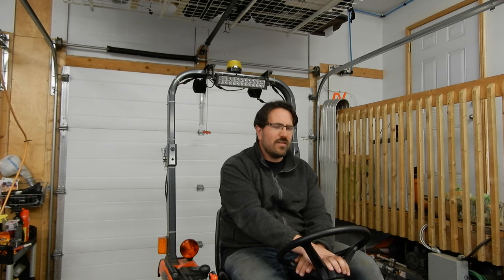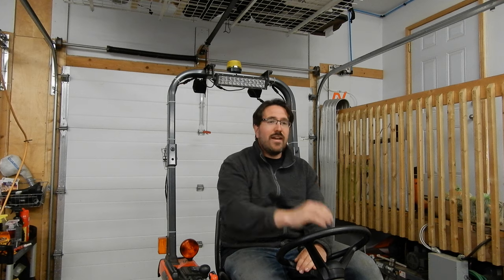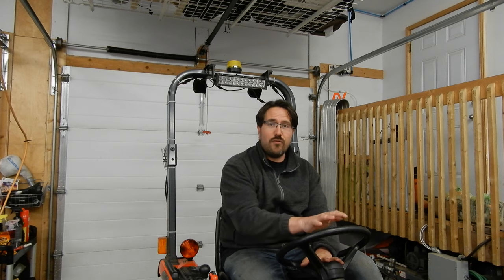It's not actually an alternator but for simplicity I'll call it that. The stock alternator only produces about 15 amps of current - about 180 watts of power. So if you're adding lights or other accessories, you have to make sure they're not drawing too much power. It's really easy to go over 180 watts. The front headlights are 28 watts each. I did this upgrade a long time ago and purchased 6-watt LED headlights. I've now purchased new 8-watt ones - we'll see if there's a difference.